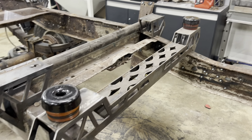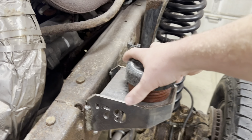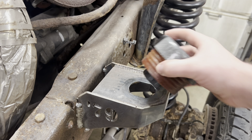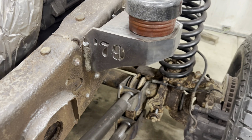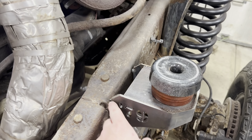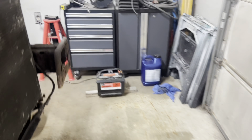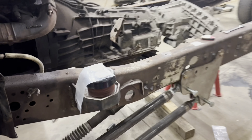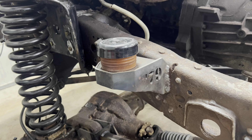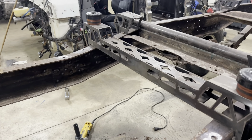The rear one is full solid all the way across and uses the newer style bushings. Same thing with the front ones — they use the newer super duty cab mount bushings with that keyed shape cut in so they lock into place. I can cut whatever year you want into them; I just cut '79 on mine. These weld onto the frame and there's one for each side. I'll get some measurements on where I placed these.